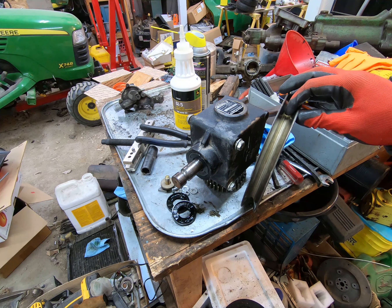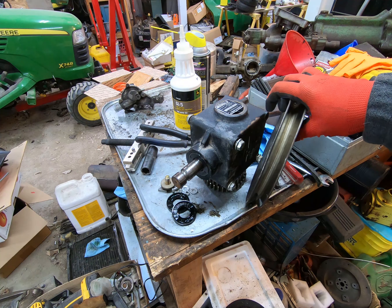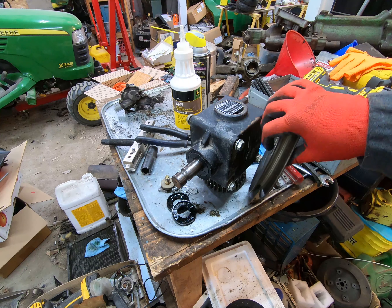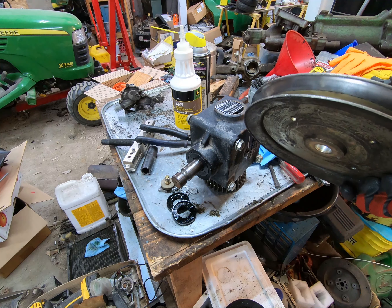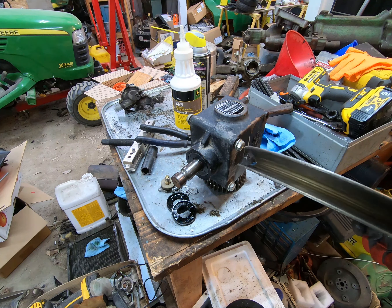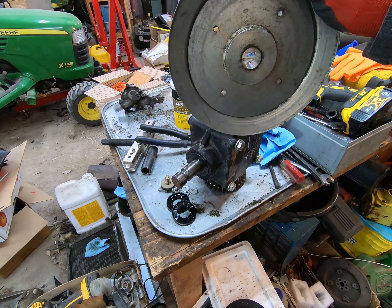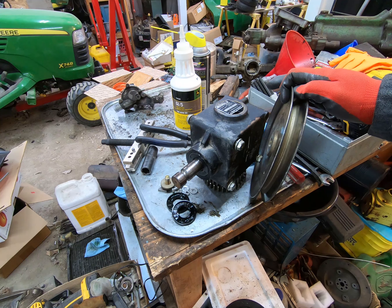After some thinking, I opted to give this old pulley a thorough inspection. This pulley came off the gearbox — I used eight tons of pressure to get it off. I decided this is not a high tolerance part; it's a belt that goes on it, and as long as there are no burrs and it's not completely out of round, this pulley should be fine.